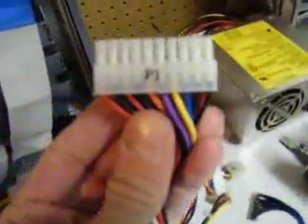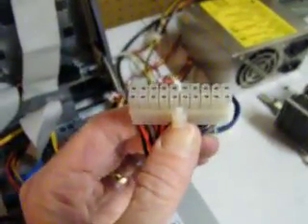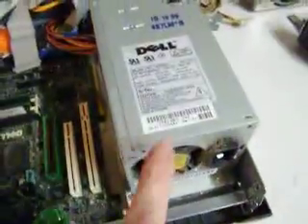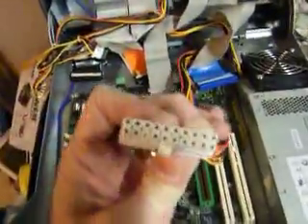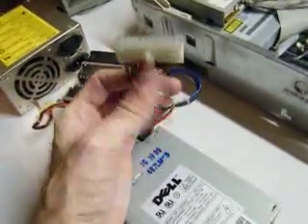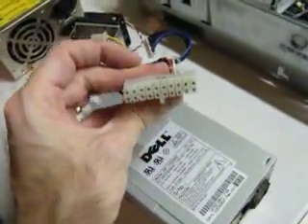The other side of the connector is the same way. You'll find that if you connect this Dell power supply to this Dell motherboard using this standard ATX connector that everybody else can agree on how to use, you're going to do one of three things: you're going to blow the power supply, you're going to blow the motherboard, or you're going to blow both. Simply because Dell decided they would take a standard and bastardize it and make it something else that only they could use. So I can't put that power supply in here. That power supply is basically junk for anything because of that weird wiring. I may be able to pull the wires out and rewire them, but I'm not holding my breath — it's not really worth it.